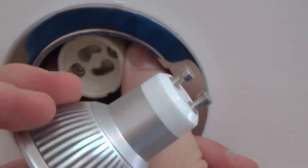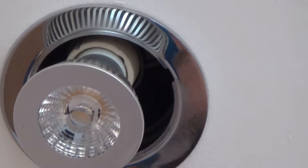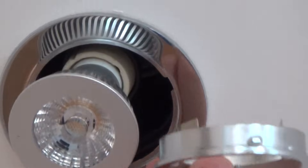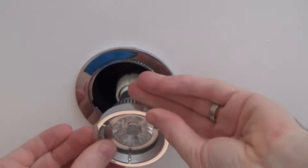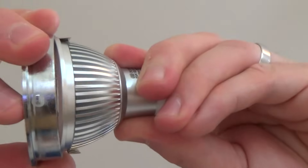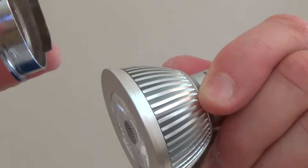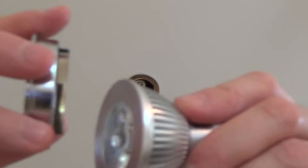To put it back in, you just put it into the round circles, twist it clockwise, and that's it — it's back in. Then you just need to slide the halogen back onto the clips and it will pop into place. With these ones, you just lift the halogen up and push it out of the fitting, as they're just held in with this little clip. That just slots in — nice and easy.